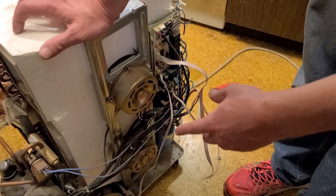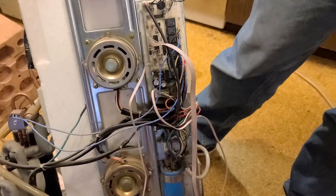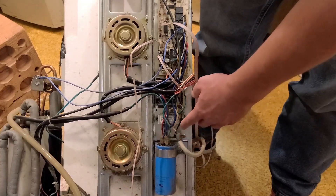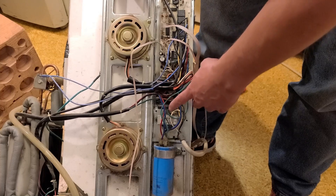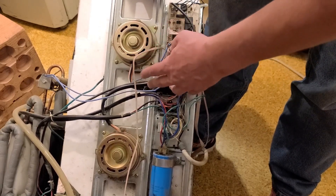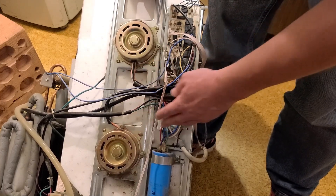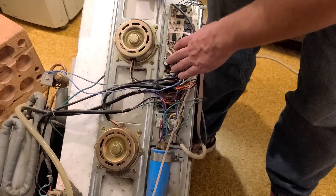The compressor needs a big capacitor because it starts up with a lot of current — there's the big capacitor for the compressor motor. We have a transformer giving us 12-volt output and a few capacitors on the board. What I find interesting is that these are multi-speed induction motors — not particularly powerful, but they go low, medium, and high just like a box fan. The upper motor has six wires going to it and the lower one has four wires; some go to the capacitors, but I think one motor may have three speeds and the other two speeds.